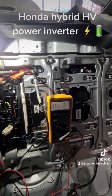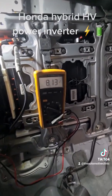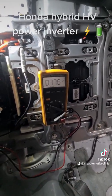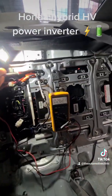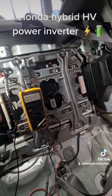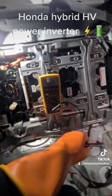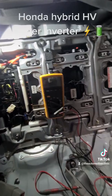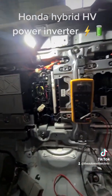We've just disarmed that system. As you can see, we still have voltage on there — that's all the capacitors dying down. So we're going to let this sit, walk away for 15 minutes, come back once it's fully disarmed, and then we're safe to work on this system. We've obviously got high voltage gloves on when we do that to make sure it's all safe.